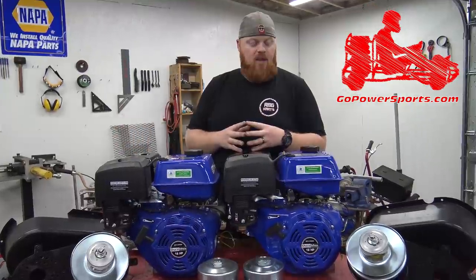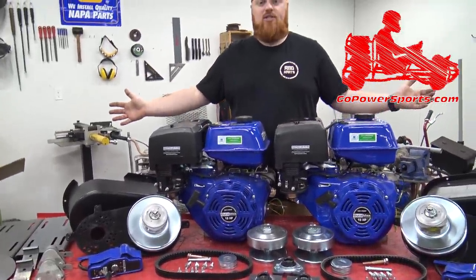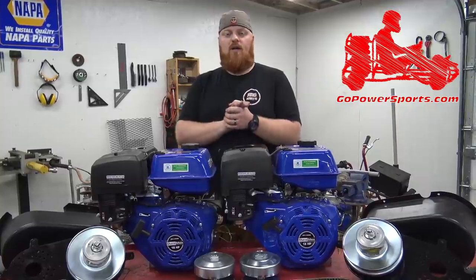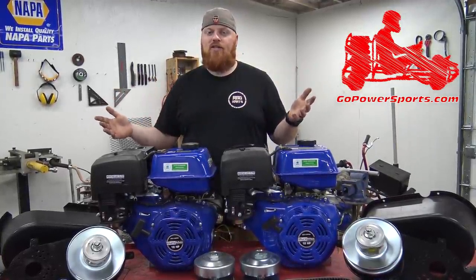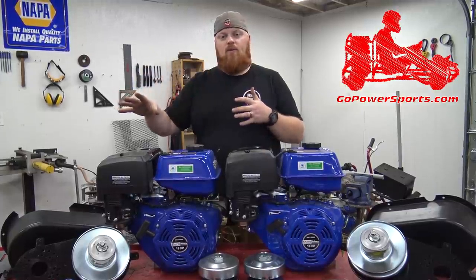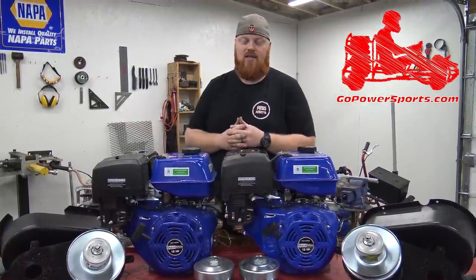We need that swing arm just to have a comfortable amount of room between each engine and make maintenance easy. We're going to use a 54-inch axle on this build just to get past the sheer size of the engine swing arm. The only bad thing is we're using the Yerfdog budget build — the one with the Tecumseh 6.5 horse — and the go-kart frame itself is only 34 inches wide, so this is going to be a monstrous wide axle sitting behind the go-kart. In a later build we'll extend the front end and do body modifications so it doesn't look so wonky.